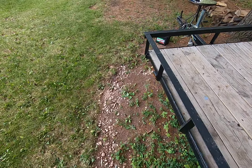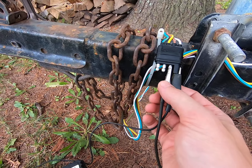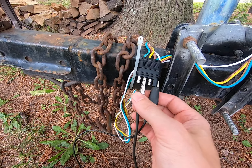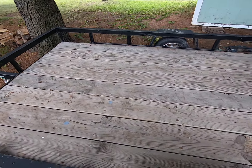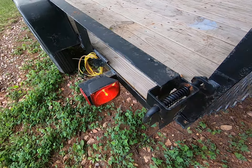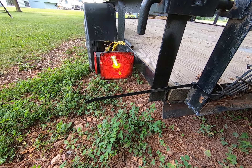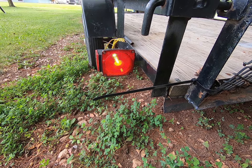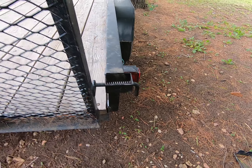Let's swing back around and test the two blinkers. We'll go ahead and do the yellow one first — let's go ahead and disconnect that. Now we're on the yellow side. Like I mentioned, this is the left-hand side, so this would be as if while you're going down the road, this is the side that points towards the center line. You can see here that the back right is not lit up now.